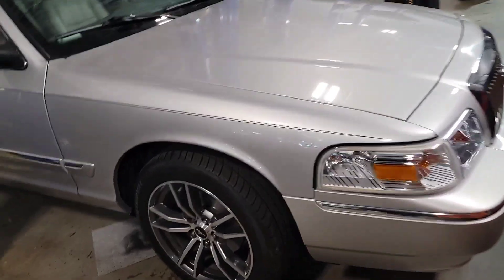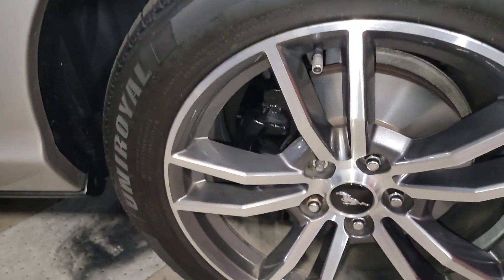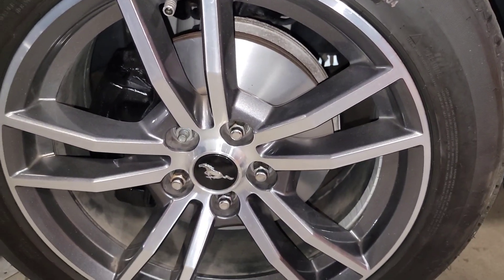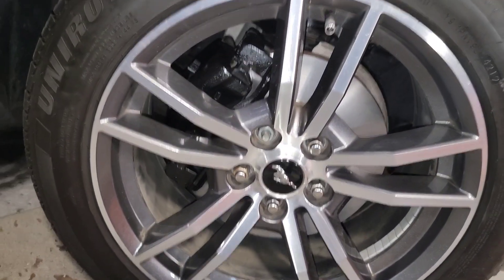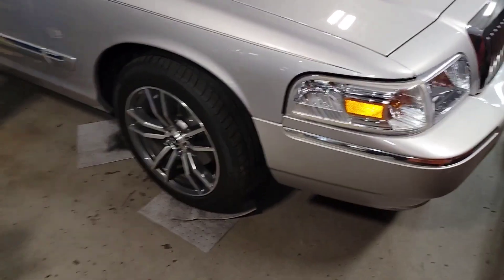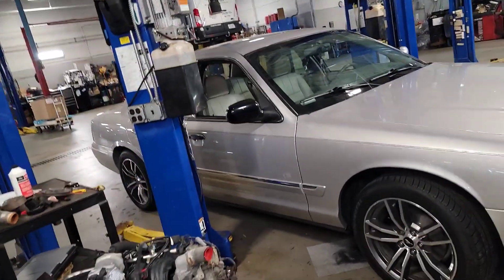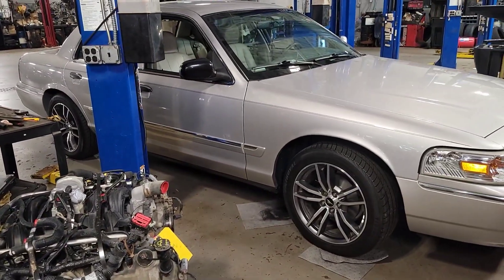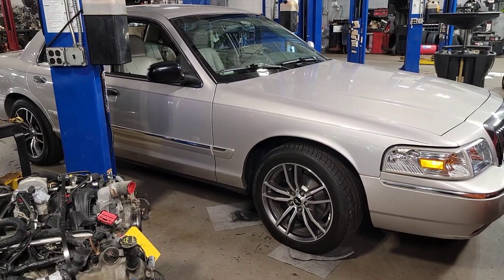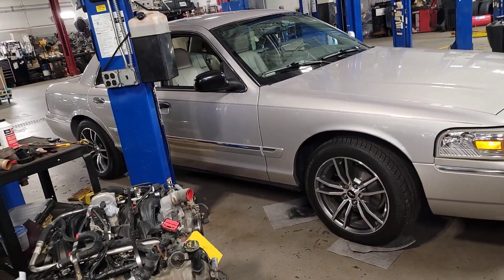So this is what I got done doing. I just got done cutting the rotors for the front on the Grand Marquis and painting the calipers, the bracket, cleaning off any spots that may need some kind of attention. I went with the CVPI severe duty brake pads. That's the update for right now on the Cherry 2007 Mercury Grand Marquis garage find.